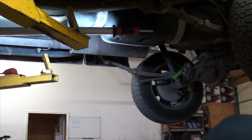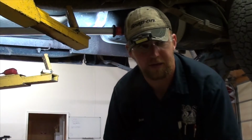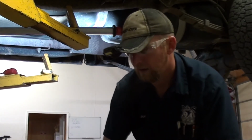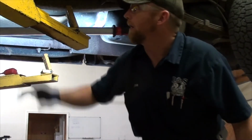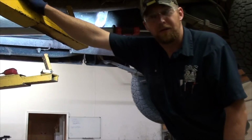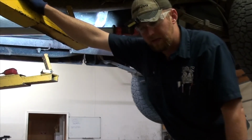But I just wanted to touch on those two points. One, always do your own test drives, before and after on drivability complaints. If it's something simple like, oh, the alternator went out, well, okay, you can confirm that without doing a test drive initially. You do need to do a test drive when you get done, make sure it's charging, make sure it doesn't throw the belt.